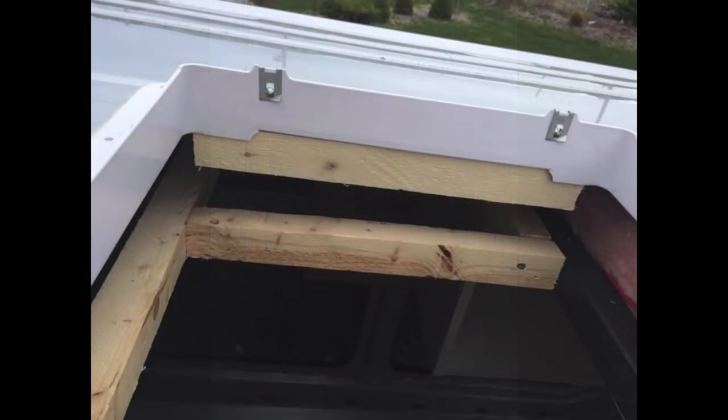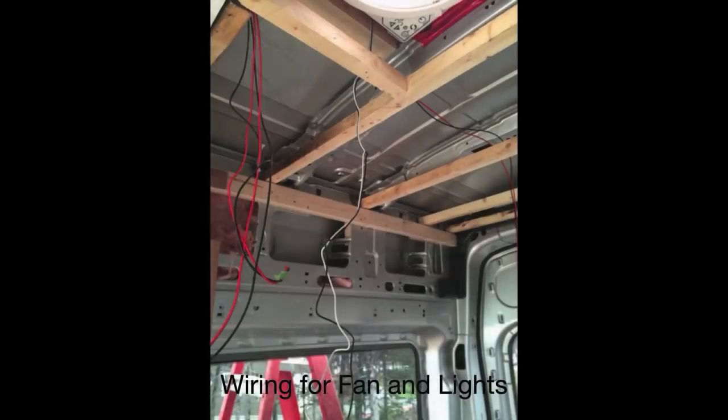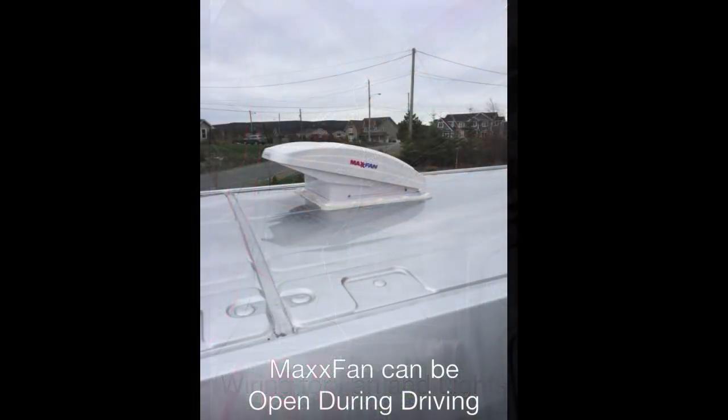There you can see the gasket I bought at a local RV center — much like a tape, you just stick it down and then put the roof vent onto it. We haven't had any leaks, everything looks fine. Then you put the fan in and do some wiring. The fan actually drives very little amperage — I tested it a number of times and it draws about 1 to 1.2 amps, a little more on the high setting, but in general about an amp.